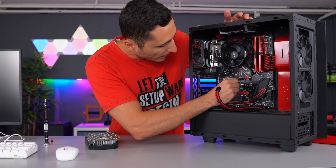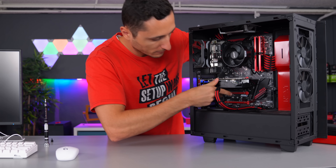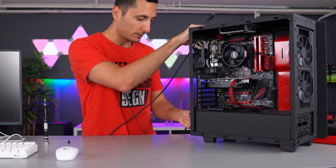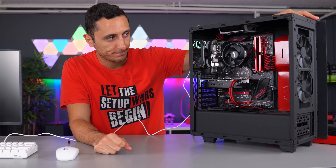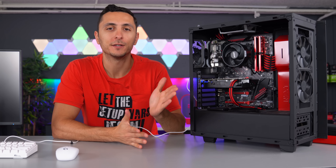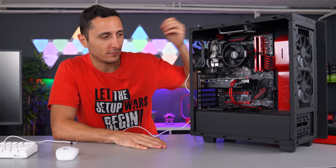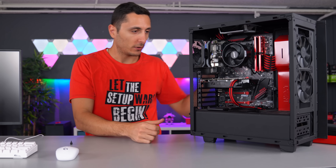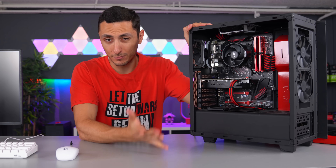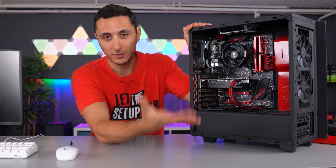All right, it's time to put the battery back in, then the GPU. Plug in the power supply cable and HDMI cable. Just as I expected — same result. Now it's time to move on to what I like to call phase two: process of elimination. We're basically going to test each component individually to narrow it down and figure out what the culprit is. We're going to start with the easy components — components that are easily removable. I like to start with the RAM first.